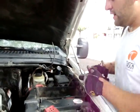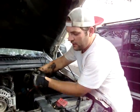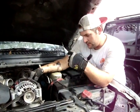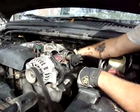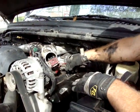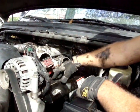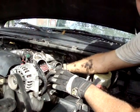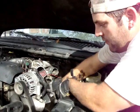Once you pull off those studs, then you can remove the valve cover. Again, you don't want to pry, you don't want to do anything crazy, because if you'll see right here, this valve cover gasket runs wires through it. It's $60 all day long for the set at AutoZone, and you don't really want to have to mess with that. Even in the Haynes manual, it says that they're reusable as long as they're not damaged. So you just kind of work them off, pull them off.